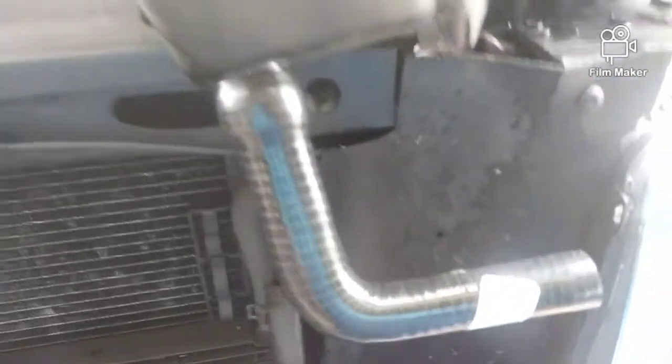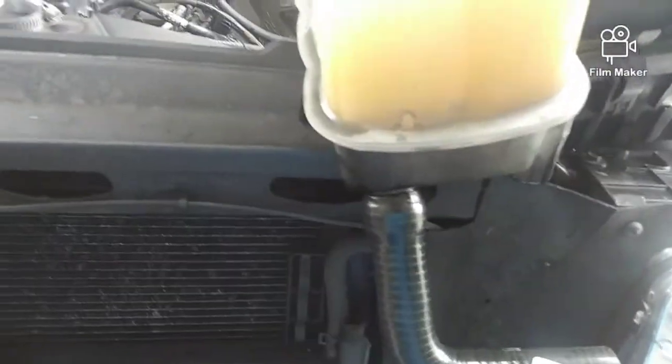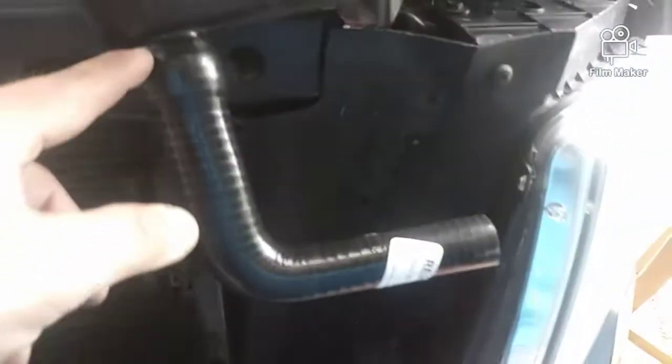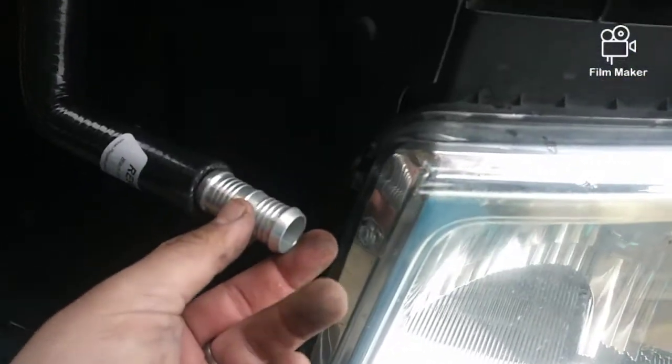That also being said, when this was in the truck I showed you where the 90 is. A little bucket like this from Lowe's is about three bucks — it fits in there perfect so you can drain your coolant out. You're going to get some runoff out of the hose itself. We're going to double hose clamp this, put this nipple double-barb fitting into here, hose clamp that, put it all back together, and I'll show you guys the final install.